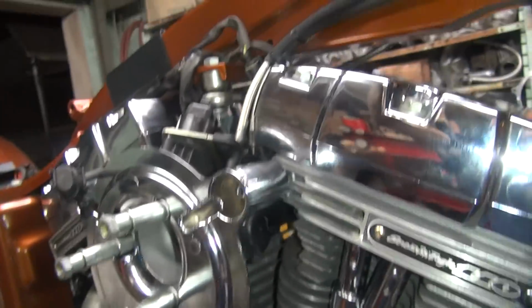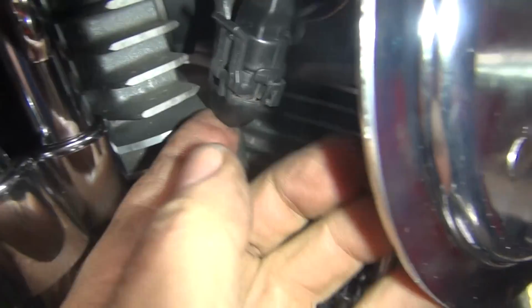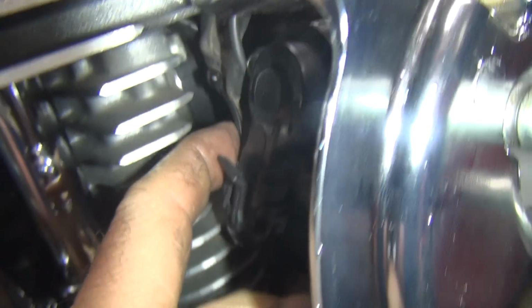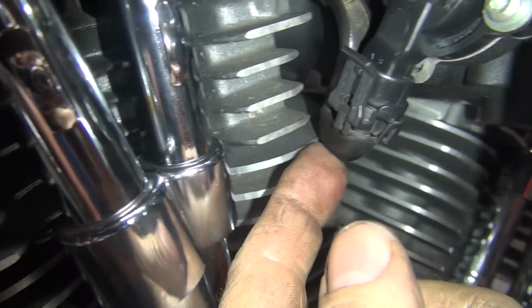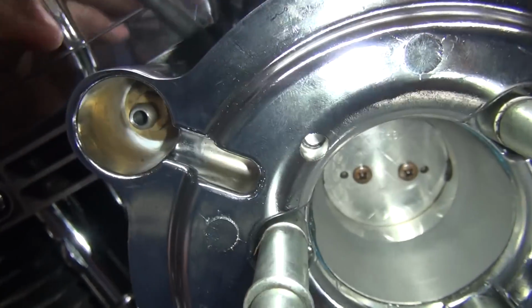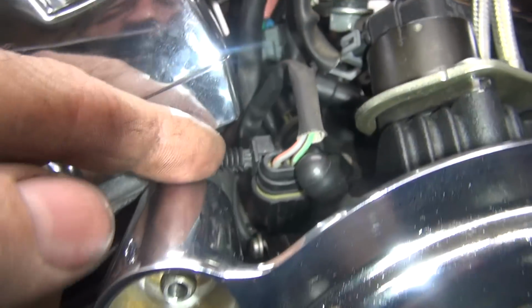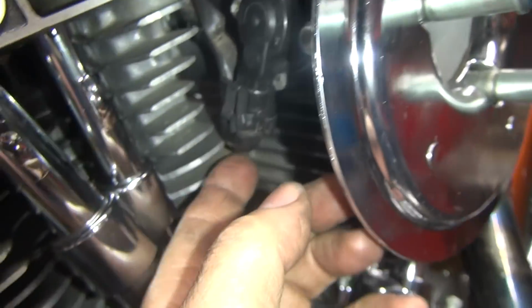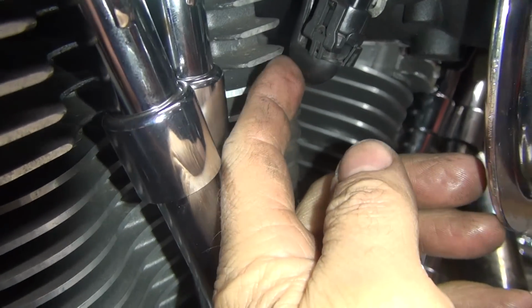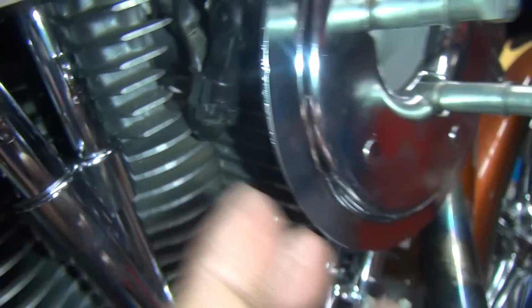Make sure the throttle still works. Still no binding. Okay. Get all these up underneath. Here's the map sensor, or the TPS is underneath. Now you want to keep that off of that sharp fin right there. It'll cut through it. So I just bent that over a little bit. So I'm just going to lay this one down inside the hole here. It looks like it's supposed to stick on the back of a stock air filter, which we're obviously a little different. So just make sure that's not rubbing on that fin right there. If it is, I'd cut the damn fin away, but right now it looks like we got clearance, so we can leave it. So that's good.